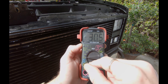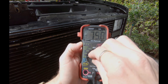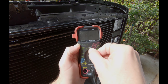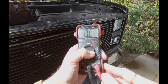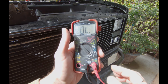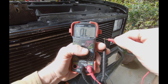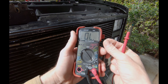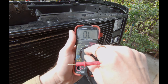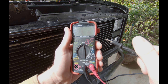Here I have my voltage tester. If I know what kind of battery I'm testing, I can put it on here, test the positive and the negative, and get a readout. I can check my milliampage — how much is being traveled through that circuit. I can check my ohms, though I don't really use that one. But I do use the continuity setting a ton. This is going to test when both probes come in contact; it gives me a tone. This is incredibly useful for testing if I have a complete circuit. Let's jump in and start troubleshooting up on my battery.